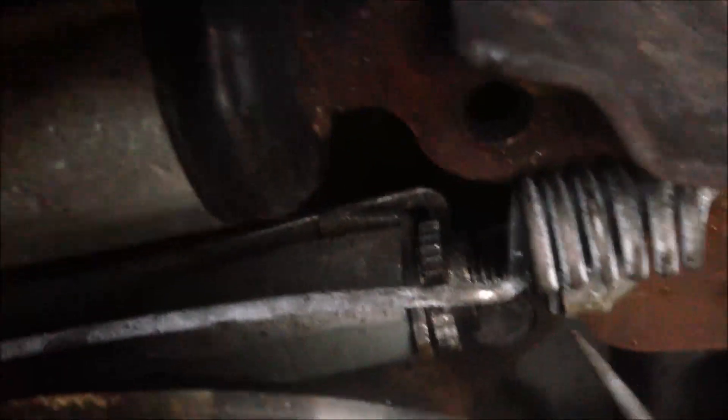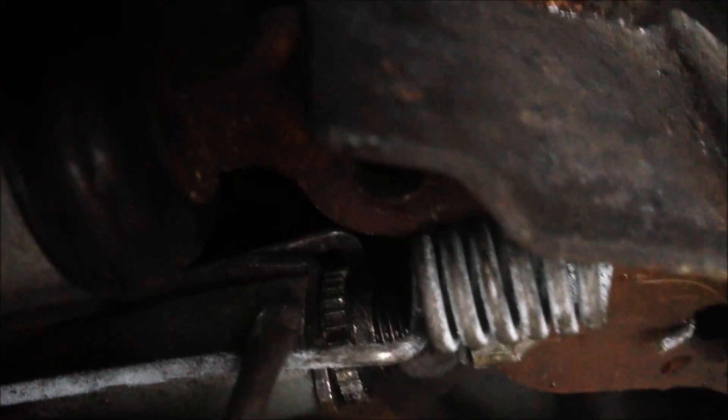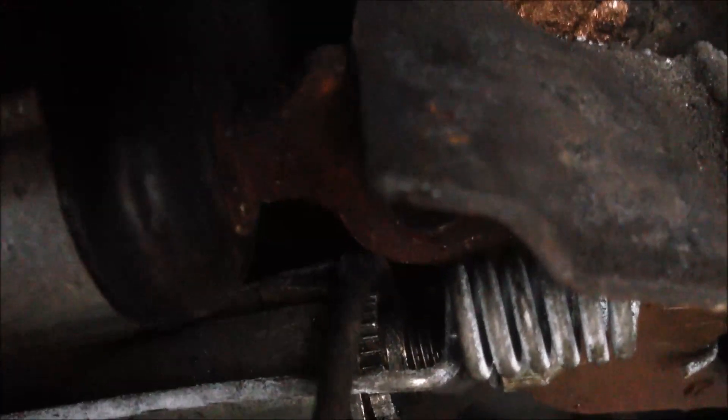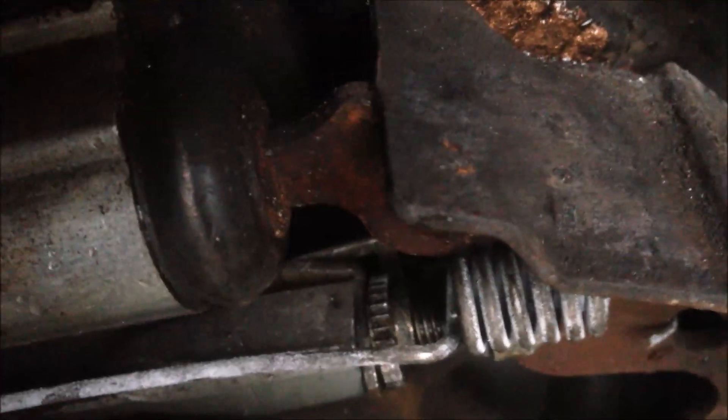Before I put the drum back, I used a brand new wire brush and some kitchen towel to clean the friction material and the drum inside. The self-adjuster star will adjust back so it's nearly flush with the other half of the self-adjuster. Remember there is an L-shaped part there, and it should be in this orientation — it pushes back against another spring — so it should be like this. Now I'm ready to put the drum on.